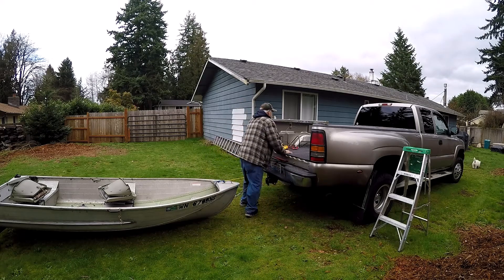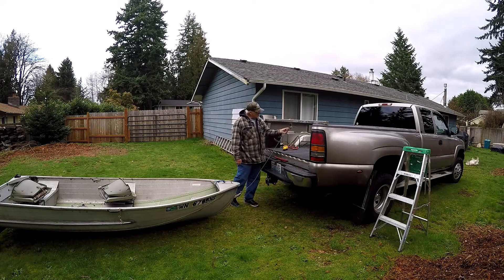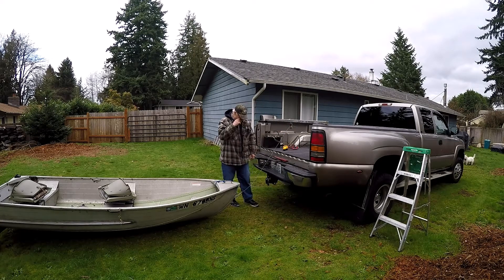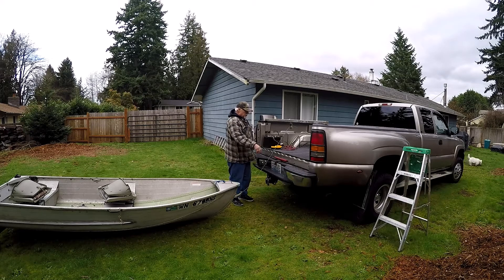What I've got is a bar across the top, anchored into the post holes on the truck. I have a pulley here — an open pulley — and I put the cable in and take the cable out. I have it hooked to the hook spot on the boat. I took the tailgate completely off. All we want to do is get this up so it's right here ready to load, and then the rest is just pushing it on there. Let's lift it up.